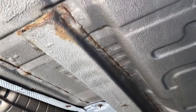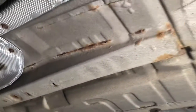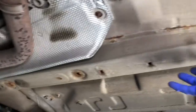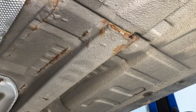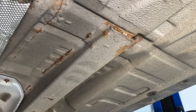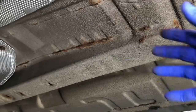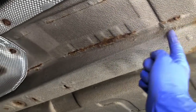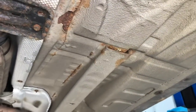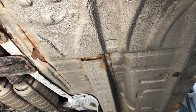The only option is to replace panels or certainly recondition panels, and that means cutting these panels off. As drastic as it sounds, it's chassis leg removal — either buying new panels from the manufacturer, in this case BMW. If the panel is too affected to reuse, it might be salvageable, but whether it gets reused or replaced, it still has to come off the vehicle. There is no way you can leave corrosion underneath contact patches and call it a success or even a restoration, because it will just come back. There is no real way around it.